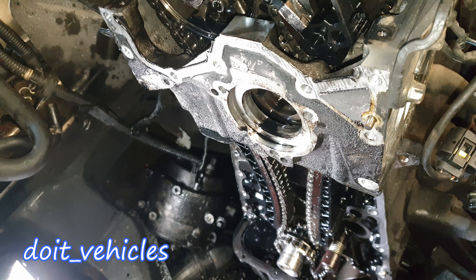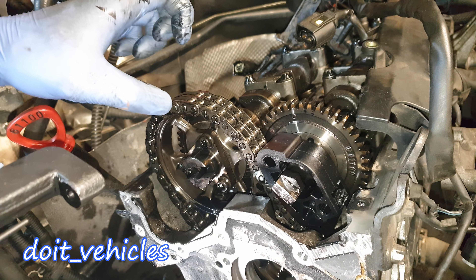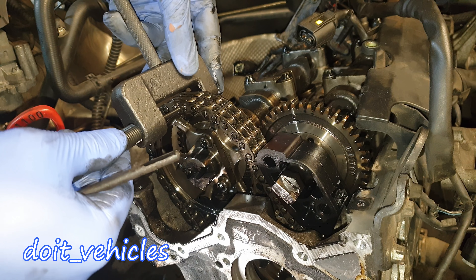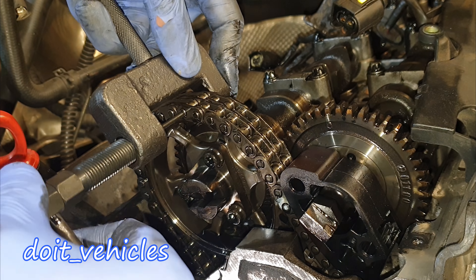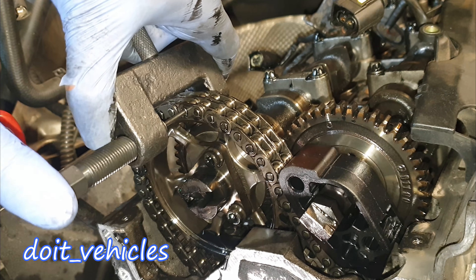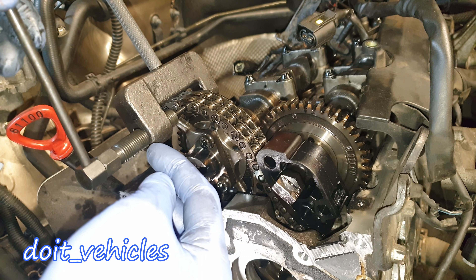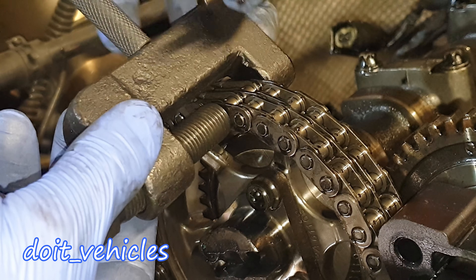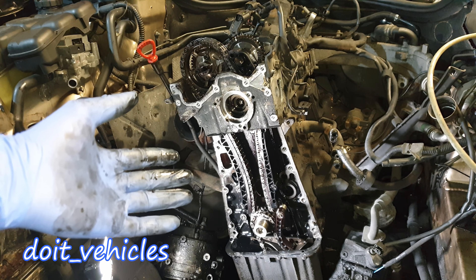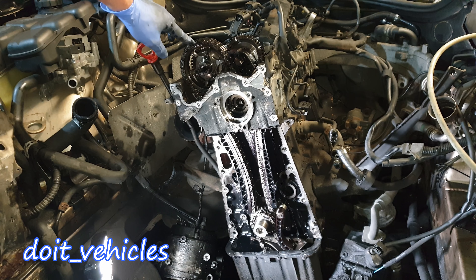On this tool you've got a hole which you have to match with the pin on the other side. Make sure the tool sits straight and begin to tighten it. If the tool is old, lubricate the threads and it will go in a lot easier. The pin is out. It's a good idea to take some pictures of the chain before you remove it, so you know exactly where the link was and when installing the new one you can make sure the link sits in the same position.